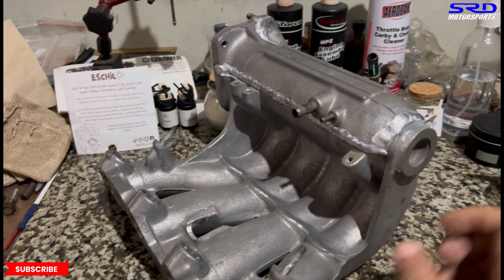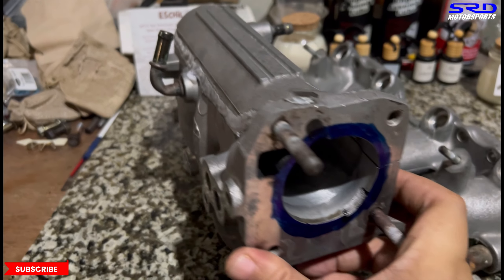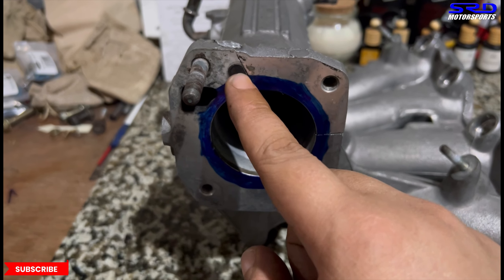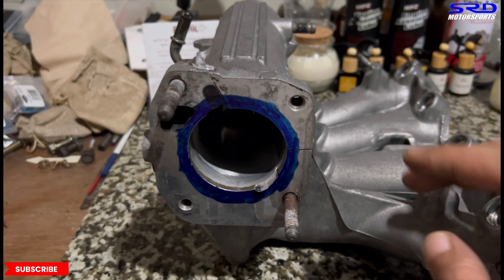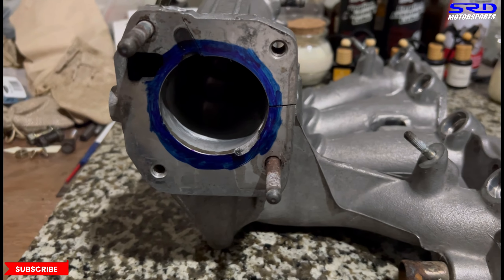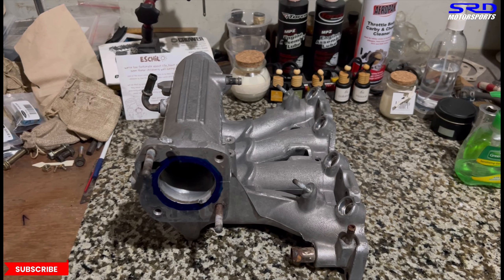Now here it is all welded — through and through, all the backside. This looks really, really good. It's tough and good because it's TIG welded. We actually leave the flange unwelded for now until we port match it. After we port match the throttle that's going to be used, we send it back to Carlo to weld up the flange and send it off flat. It's easier to do it this way — it avoids warping. You can weld it all together at one time, but we've noticed that causes a lot more warp. Unlike this way — it's all welded and it won't warp after.